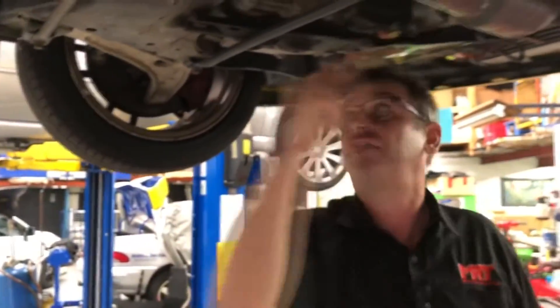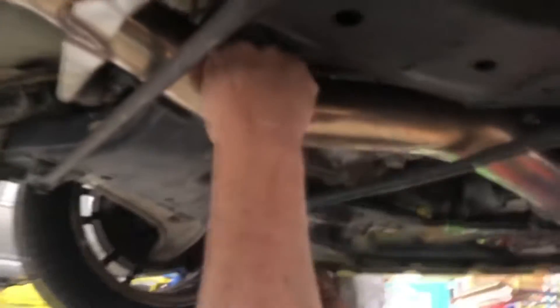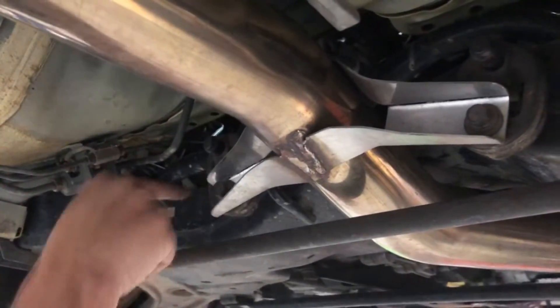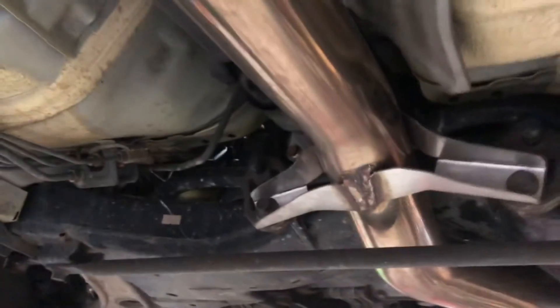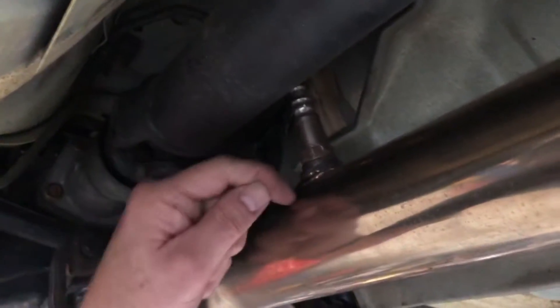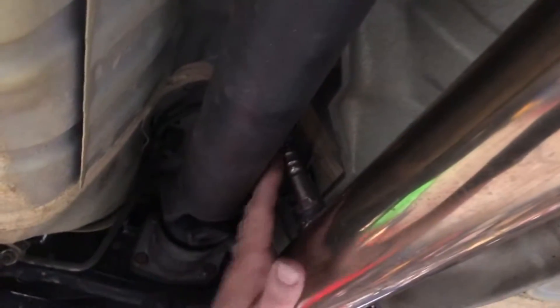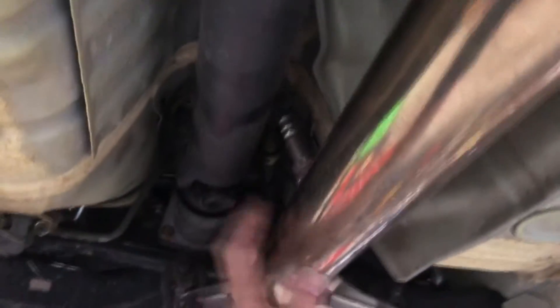Unfortunately, some workshops actually take this off and chuck it out. In some extreme situations you might have to put a spacer in and space it down a bit. But if you look up top here, you can see how close our exhaust system is to the crossmember on the K-frame that supports the engine — it's a very, very tight fit. You go around the back of this stiffener and the exhaust system is rubber mounted off the back of the K-frame, while the front half is mounted off a flexible joint at the bottom of the turbo. We then fit a rear O2 sensor on this side here — it's important that this is both at the right depth and the right location from the turbo for accurate results. The wiring needs to be tucked up out of the way so you don't do any damage on the tail shaft, because when you're driving, that part spins.